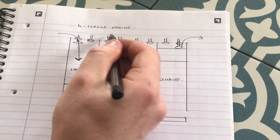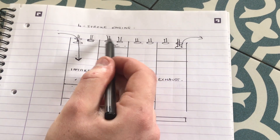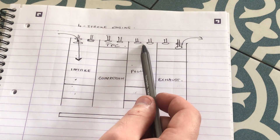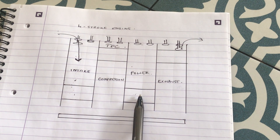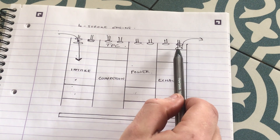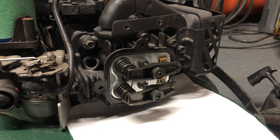At the top of the compression stroke, also known as top dead center, both valves are closed. This is the point — just before the power stroke — at which you can adjust the valves and check the clearances. The third stroke is the power stroke: the fuel-air mixture is ignited and you get internal combustion. The power stroke pushes the piston down, and then finally the exhaust stroke — the piston comes back up and the exhaust gases exit through the exhaust valve.